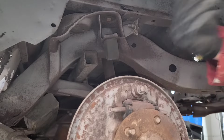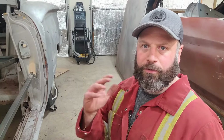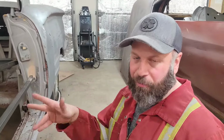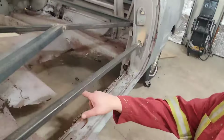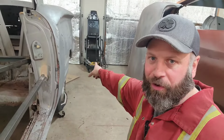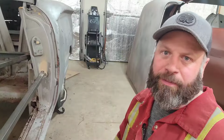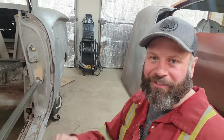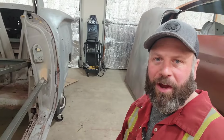Beauty, boys. So guys, I got 10 of the 12 bolts out. 2 of them are not working. This one right here, it's just spinning around. The nut is just pretty much seized in place. And the one on the far corner, same thing, it's just spinning in circles. So anyway, gonna take the body saw, gonna cut those off. That should solve the issue, and then we can get the car up off the frame.